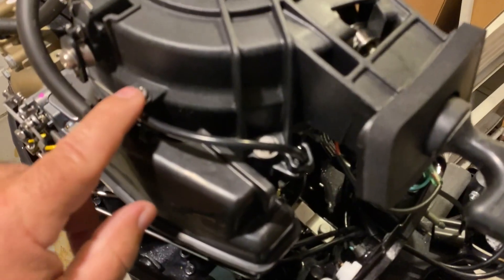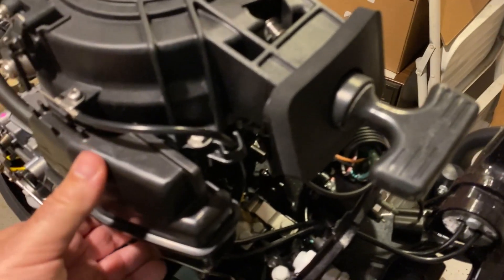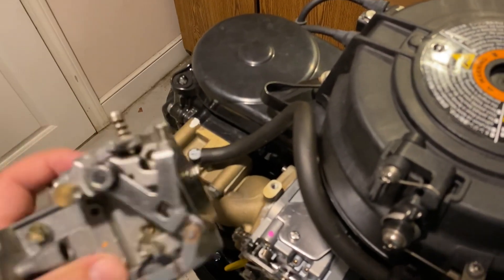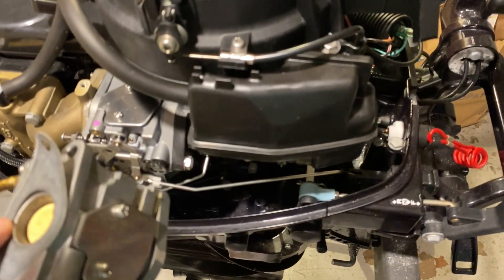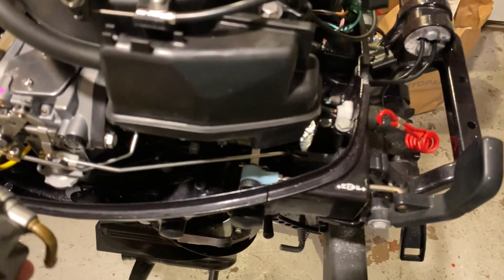Initially I took the air filter off, but that's actually unnecessary — it's not in the way. Once you loosen the air filter and take off those two screws, the carburetor just separates right here. You can see the 8 horsepower positioned exactly how the 9.8 would be. It has a gasket which you have to maintain, and then you literally place the new larger carburetor back on.